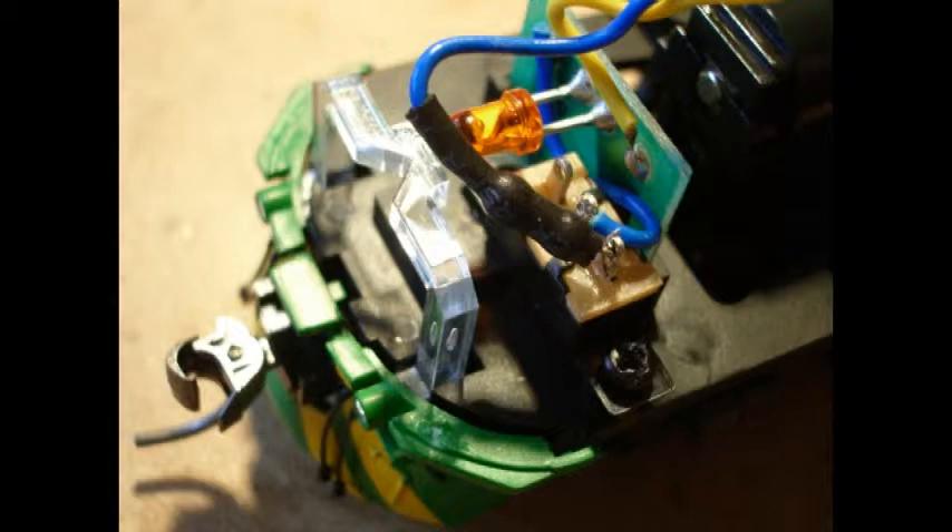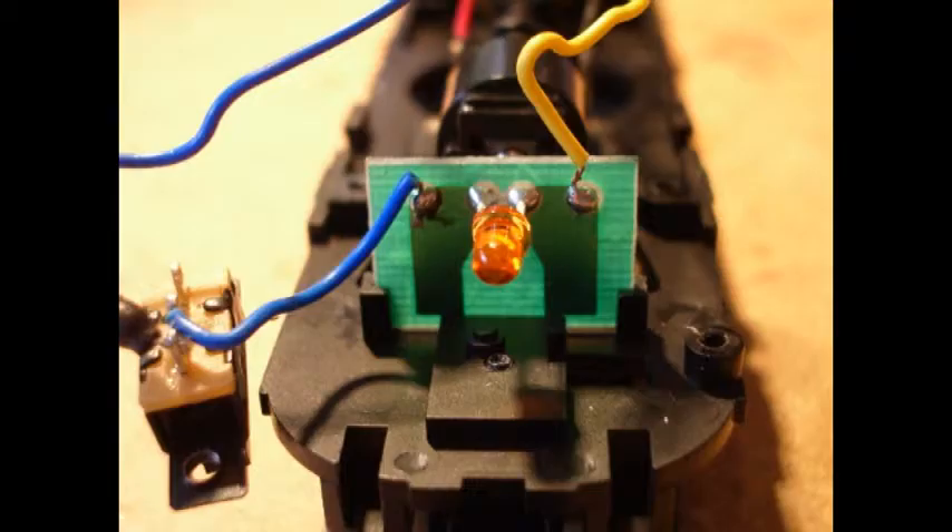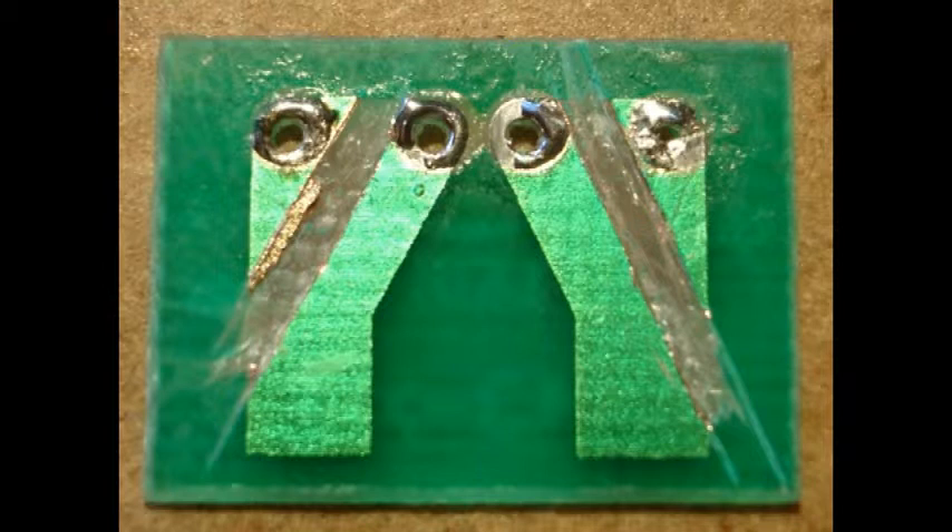Unclip the pilot from the two wings at the side and carefully remove it. Unscrew the switch and then lift out the printed circuit board. If you look at the printed circuit board that's got the ditch light on it, you can see through it, as on the photograph here, to the tracks on the other side. Unsolder the wires and unsolder the LED and take it out.